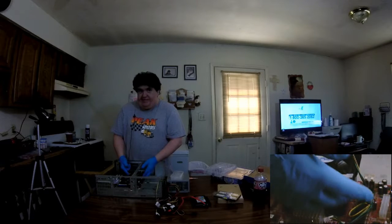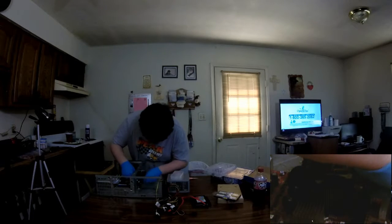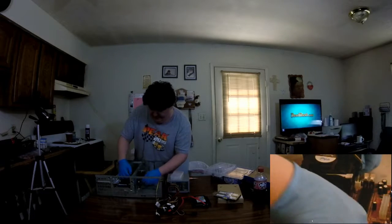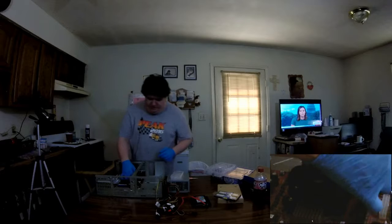It's on there — slowly flip these clips over and it's mounted. Like I said, I can still move the heatsink. That's why I wanted to find a better cooling solution. I have found several parts on Amazon for a make-it-yourself liquid cooling system, which I might go with — just to see what I could do with water cooling on a Socket 478.